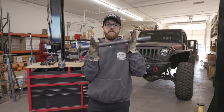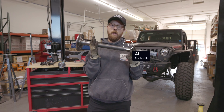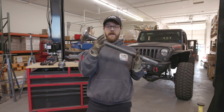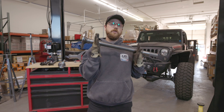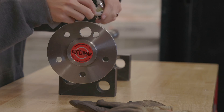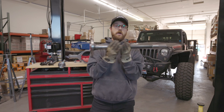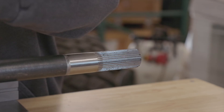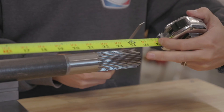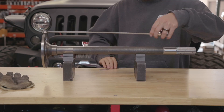This is a press-on bearing axle shaft. On our order form the length is called the AL, and we have left and right for left and right axle. We measure this the same way we'd measure our C-clip axles — from the outside face where the rotor or drum would mount. Hook your tape on the axle flange, pull to the end of the shaft, then use a straight edge to come up from the end to your tape.